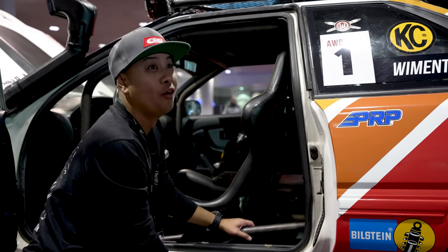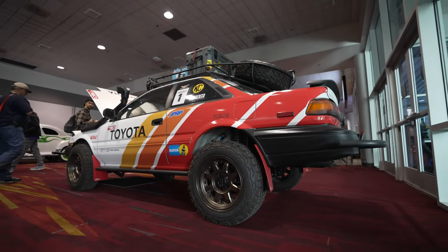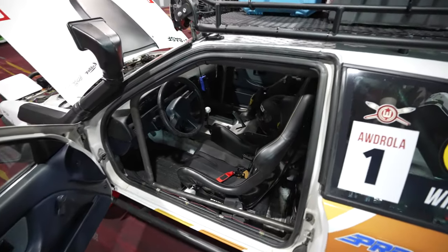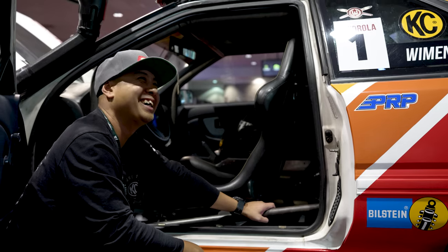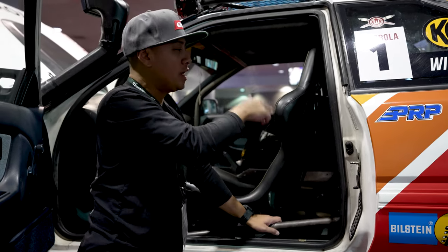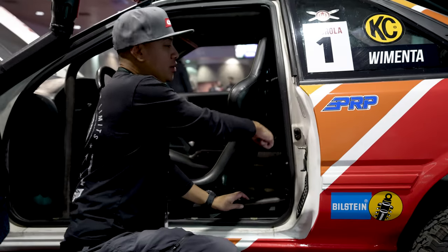Are the sliders tied into the cage? This is separate — also custom. We just cut it up literally in our garage and welded it all together. This is the subframe we needed to make it a four-link with the rear axle and to give it that travel. It's like a little baby pre-runner. It took us about almost a year just to do that. Underneath there's aluminum sheet so that if anything happened with the rear axle I could get into it and work off it.